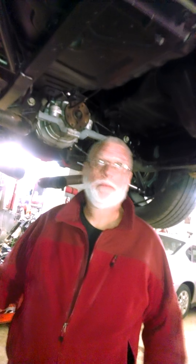We're running new brake lines because the lines are different for this IRS than they were with the solid axle. The new lines are routing up the side. The original lines are still in there but they're coming out. The underneath side of the car — since it's an Ohio car — had a little rust on it, but nothing structural. Once we got the engine out, we had the underside and engine compartment sandblasted and painted semi-gloss black.